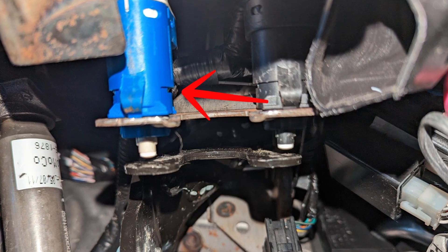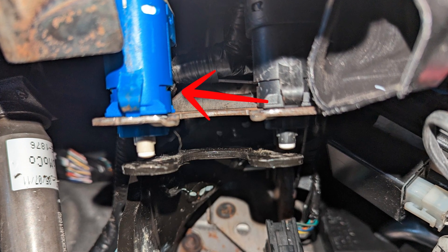I've also seen this error message pop up because of a malfunctioning brake pedal sensor, so you may want to check it. The brain of the car didn't get the information about the position of the brake pedal — it couldn't verify that the brakes were applied, so it just turned off the start stop function. This is not that common but worth checking anyway.